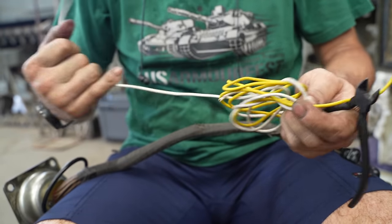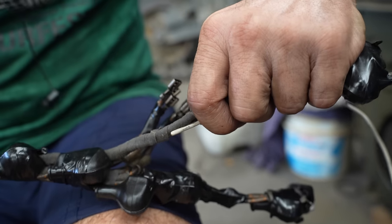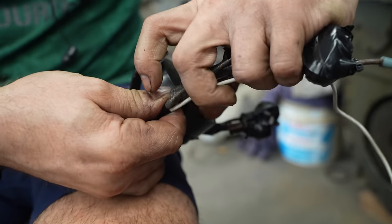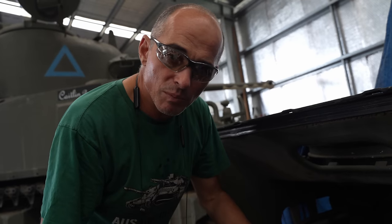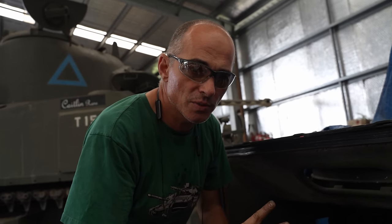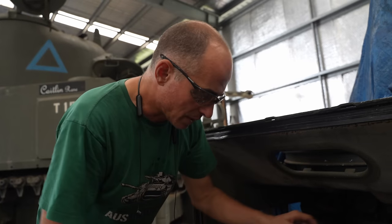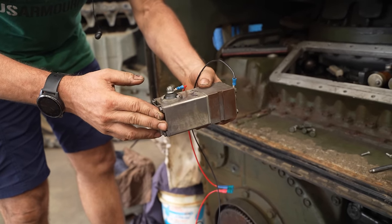Steve will use these wires to help pull the head of the Medusa through. Before we start on threading the wires back in, I've still got one more solenoid to fit into the transmission. As you recall, we've got two that were suspect, one that had failed completely. I've already replaced the two suspect ones, so now it's time to get the third and last one in there.